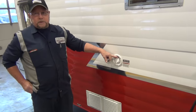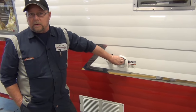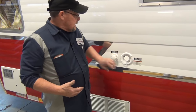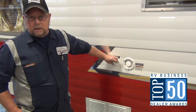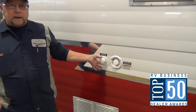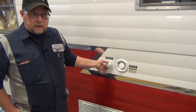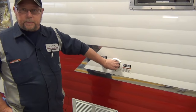This is the fresh water tank fill — this is water you carry with you, so if you're on the road you can put a little water in there and use your own facilities at a rest stop. This is your city water hookup — this is direct pressure. You want to use a white RV hose so you don't get the rubber taste like a garden hose. When you hook up here, you want a water regulator to regulate the pressure going into the coach. This is direct pressure; this other connection uses the pump.